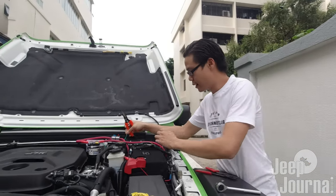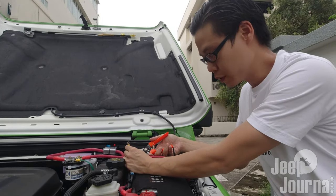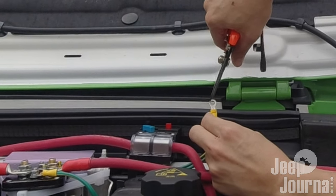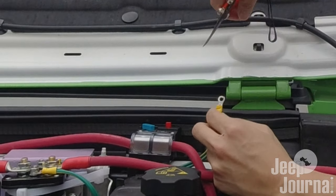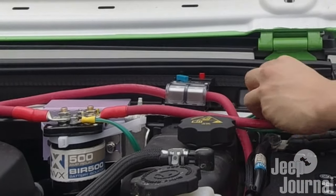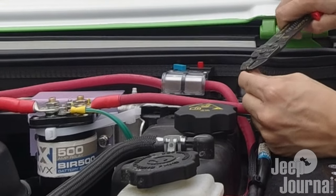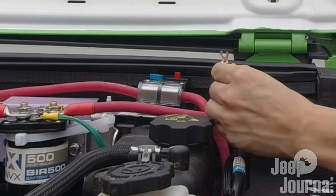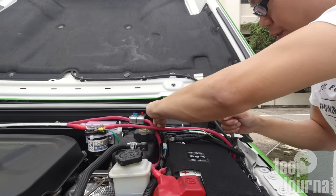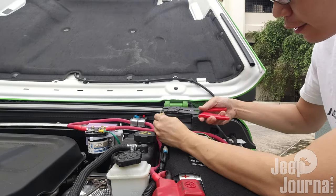Here's a tip: if you ever have a hole that is not big enough to go through a bolt, what I recommend is getting a pair of scissors and snipping off a portion of the ring terminal — like that — and then snipping off the other portion on the opposite side. Now we actually have a crescent shape instead of a ring. Let's readjust the metal back to its original state — so instead of an enclosed circle, we now have an open circle. Let's widen that semicircle a bit.